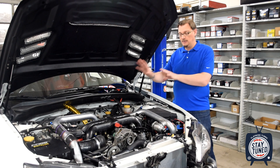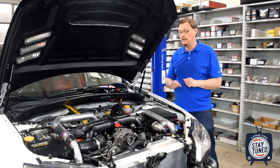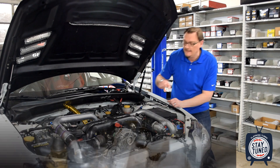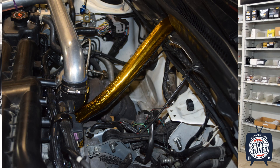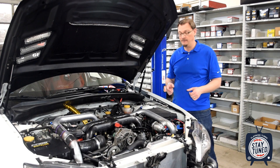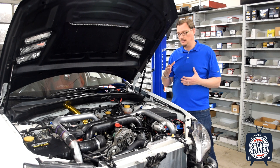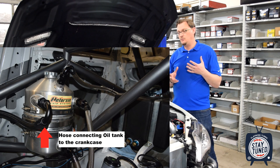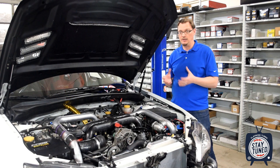As you can see now, the air-oil separator is gone. In fact, the entire PCV system is gone and the crankcase is now sealed up, with one exception. That one exception is this gold hose. The key piece of the puzzle that we missed is that we were keeping the crankcase and the oil tank basically separate, except for the send and return from the oil pump itself. Roger Clark let us know we needed a connection between the two - a hose connecting the crankcase to the oil tank - and that should give us much better performance and really help to solve this problem.